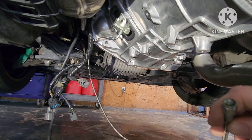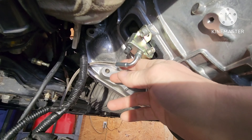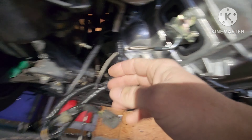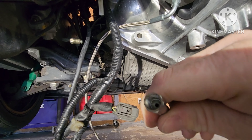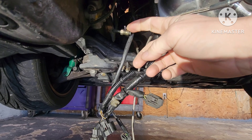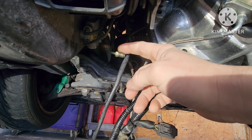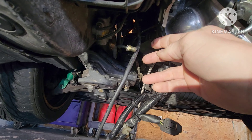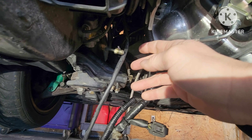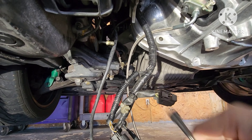I was going to hook up my clutch line. Since this is a single disc clutch you're using your factory master — it goes into the internal slave. I finally figured out the fitting: you need an M10 by 1.0 female inverted flare to a dash-3 AN male adapter. For anybody wondering how to go from the factory brake line to a braided AN line, that's what you've got to have.